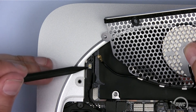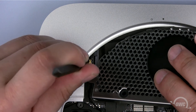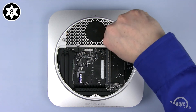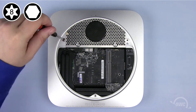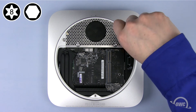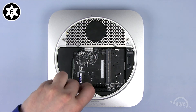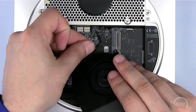Reattach the airport cable to its connector — you should only need to gently push on it until it clicks together. Reattach the two Torx T8 screws, then attach the two 2mm hex screws. If you're using a Torx T8 screwdriver to screw these in, be extremely careful not to strip out the inside. Replace the plastic cowling by sliding it into place and replacing the Torx T6 screw in the lower corner. Reattach the fan cable, then use your Torx T6 screwdriver to tighten the fan into place.